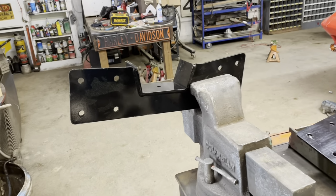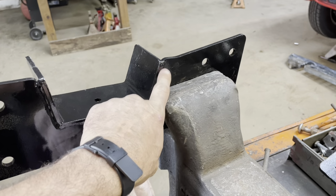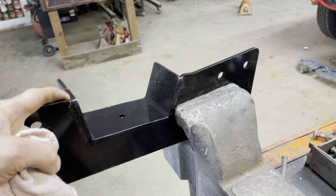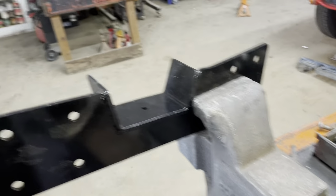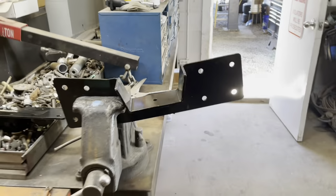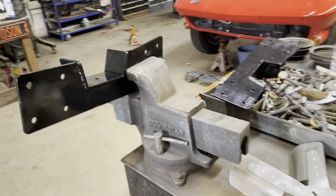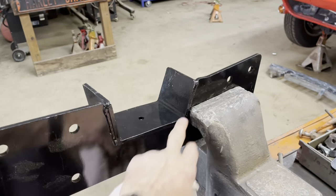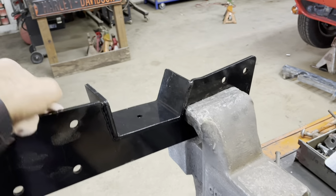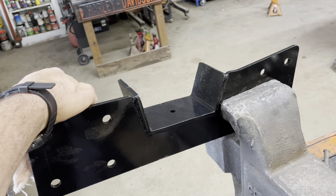What I've decided to do is take this notch kit, and I'm just gonna cut the notch out of it. And we'll cut that into the frame and weld it in. Because I can't use all this. It just is not shaped for that frame. I was going to use a half pipe, but we don't have anything that big, and it just takes so long to go hunting stuff down. So I'm going to cut that flange out of there, cut that notch out of the frame, and weld it in. And that'll be good enough.